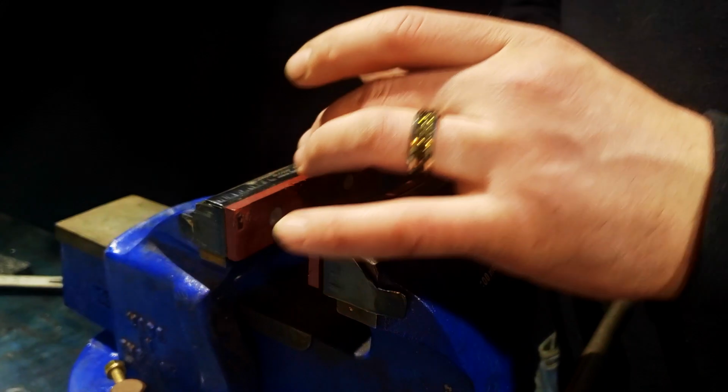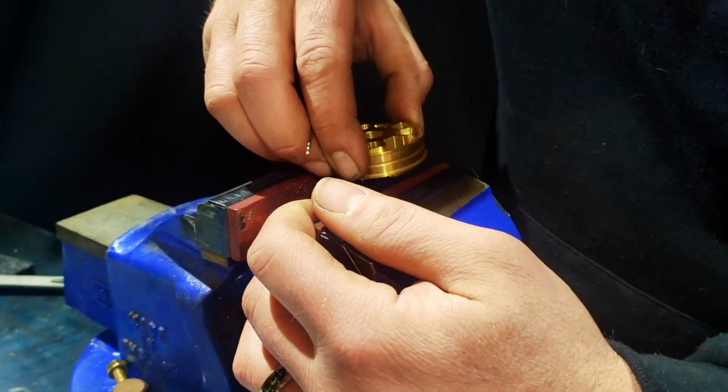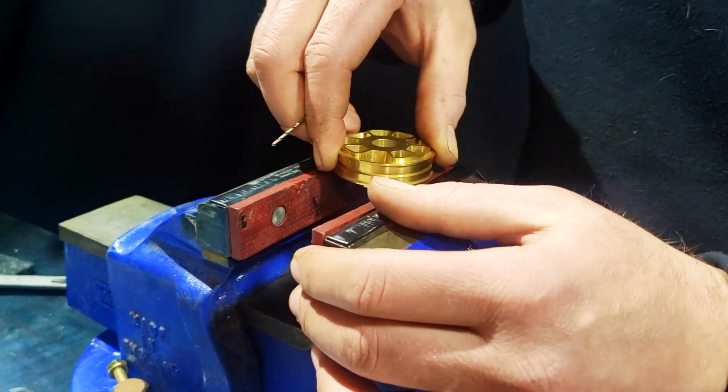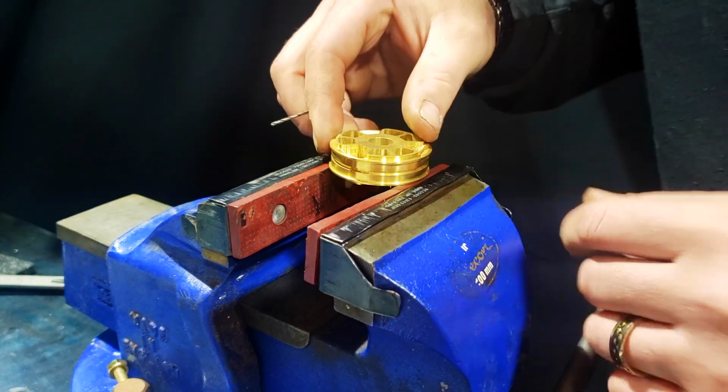So gently clamp your gold valve into soft jaws, just enough to prevent it from turning. A slight modification to the drill bit will be needed to give it zero rake. I'll show you how to do that in a different video. I'll link it in the description.